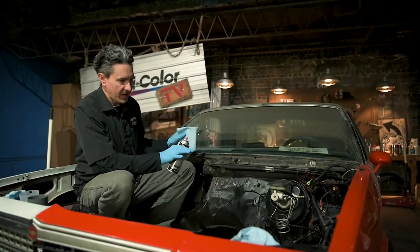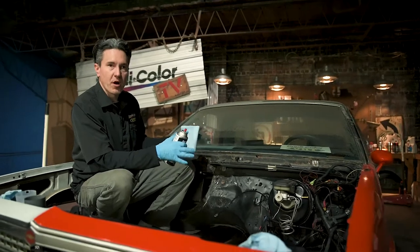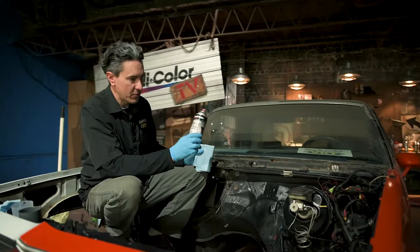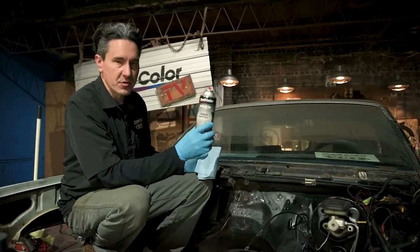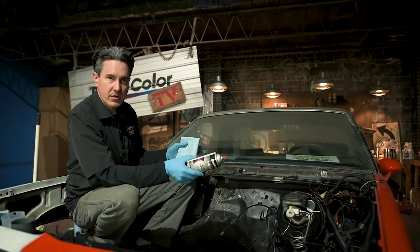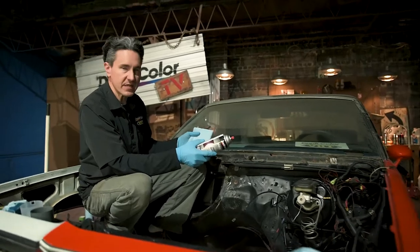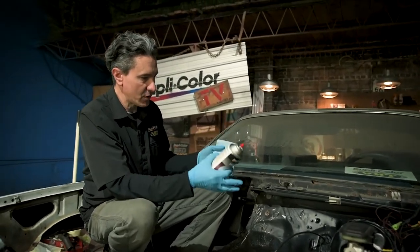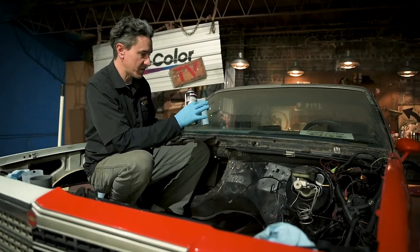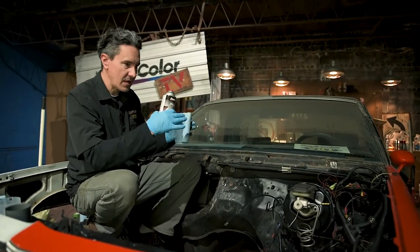I'm to the point where I have everything out of the way that needs to be out of the way. We fresh washed it, we wire brushed all the loose rust out of the way. Next up is spraying down some of the Duplicolor Prep Spray. This is our solvent prep spray — it's good for initial paint work like we're doing here. It's got to remove any oils and greases that the pressure washer didn't get. It'll give us a good clean surface for the VHT roll bar and chassis to bond to. Once I'm good and clean here, we'll finish masking off anything that needs to be masked and we'll lay down the paint.